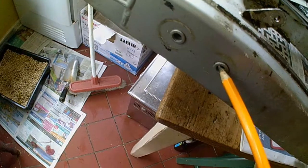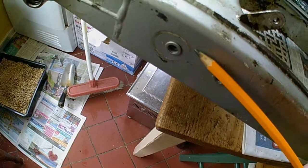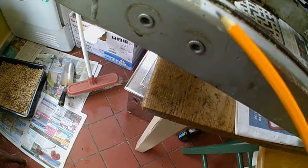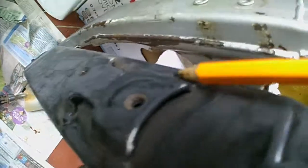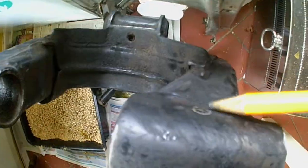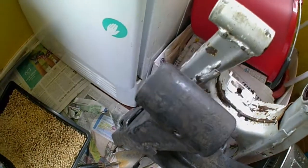This is a discrepancy with the other swing arm that I've got. Should have some sort of spacer here for the buffer, and the buffer has lost kind of plastic on here, so there could be something amiss with this, so I might have to use the other swing arm after all. Yeah, so I've put these side by side and the discrepancy is here and here. It's the only thing different. And of course this one has got a grease nipple here, which I will have to put on there. And there's one on the other side that will have to go here. But I need to make sure that this grease nipple doesn't foul the buffer when it goes there. So I'll have to make sure my measurement's good, because it's in a photo, it is snug.